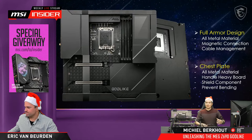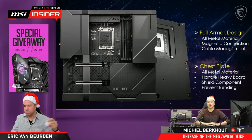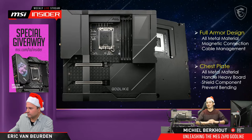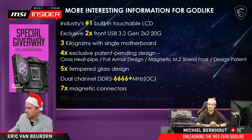So yeah, all metal backplate. It's really big. The backplate on the board itself also helps a lot. If you have a bigger surface area, it helps a lot with the cooling. With this VRM and the cooling that's on there, you can easily extremely overclock a Core i9-12900K, but you will always run into heat issues for your CPU faster than you will with the VRM on this board. That's the challenge, basically, if you want to do the extreme overclocking. For the VRM, easy. So quickly summarizing.